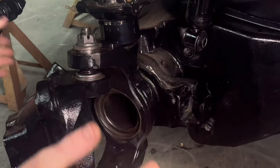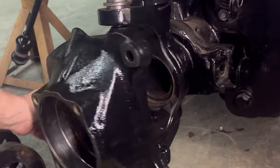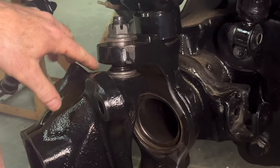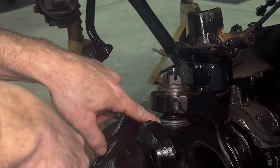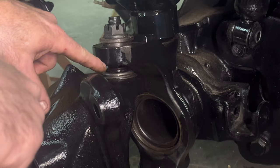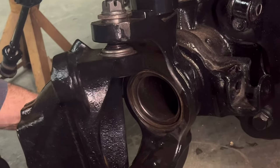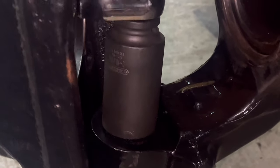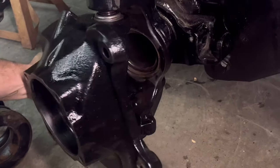A couple little hits — look at that. It doesn't take a lot if you torque it right. No squeaking — it's good. I probably could have just smeared a little grease. So if we put four ball joints on, go ahead and move the ring — I wouldn't take it off. In hindsight I would just smear grease and move the ring up and down to get some grease in between the rubber and the metal. Now we'll do 150 — drop it right through the middle. 70, 80, 90, 100 — tighten up a little bit — 120, 140, 150. Yep, tighten back up.